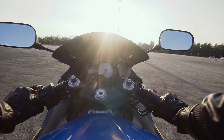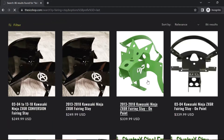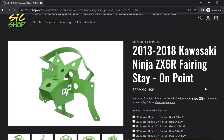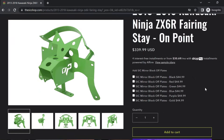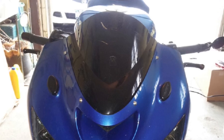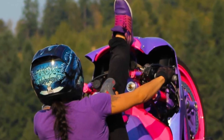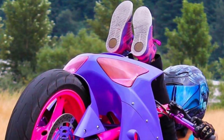The next hack is your windscreen. Most people get a front upper fairing stay which is around two to three hundred dollars, but you really don't need that if you're just learning and starting out. You just need to get your stock windscreen out of the way — if you're in a wheelie it's going to get in your way. I recommend cutting your windscreen level with your handlebars so there's room for your bike to come up and you can toss your leg over into a 50-50 high chair position if you need to.